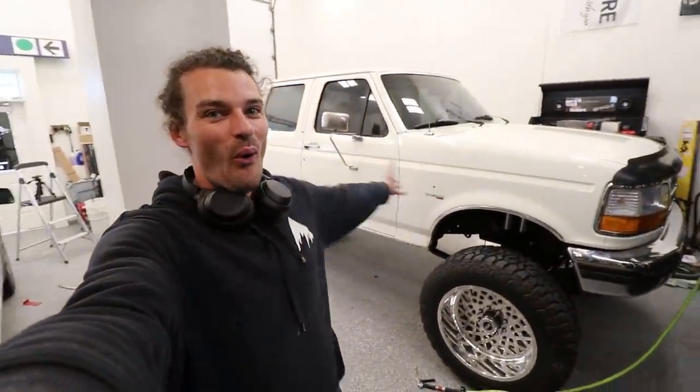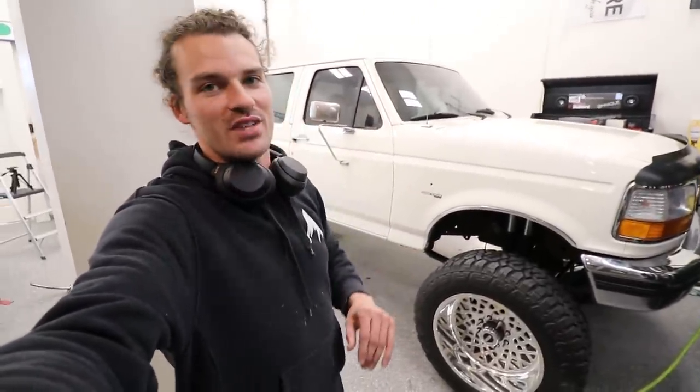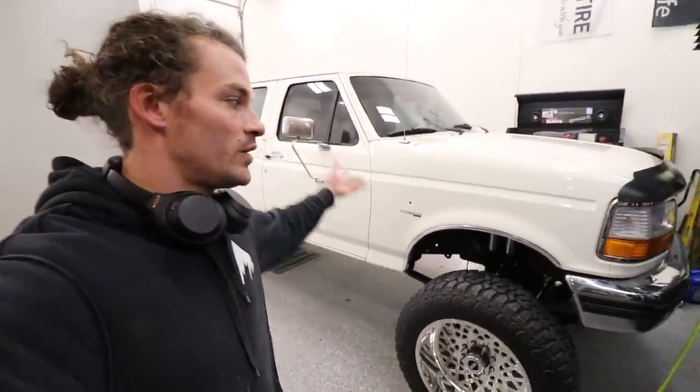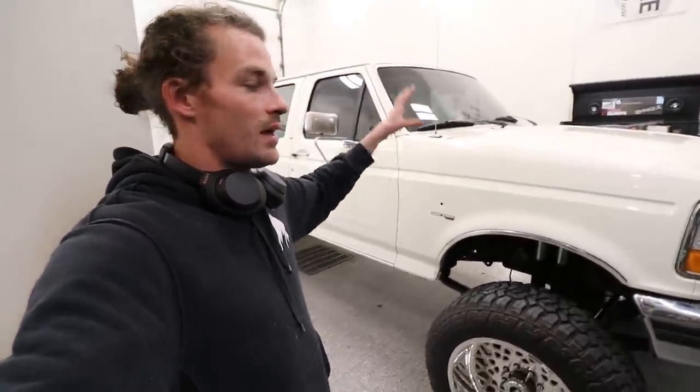We just finished the compounding stage and boy, that is a big truck. If you have a smaller car or sedan, that's going to take you no time at all. This took me forever. Some tips and tricks: keep your pad level when polishing. If you're a little nervous, maybe go on a slower speed with less pressure and just watch how it polishes the paint — you'll get to know it pretty easily. Another tip is keeping your pad clean. I have compressed air and blew out the pad; if you have a vacuum, you can vacuum it out. We're going to move on to the second stage — polishing the whole car, getting all the compound scratches out and really making it pop.